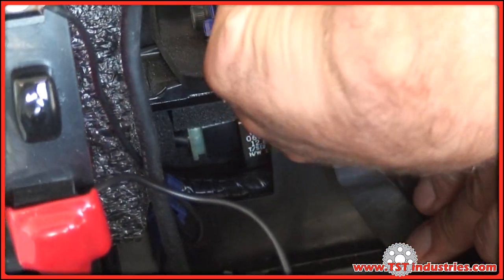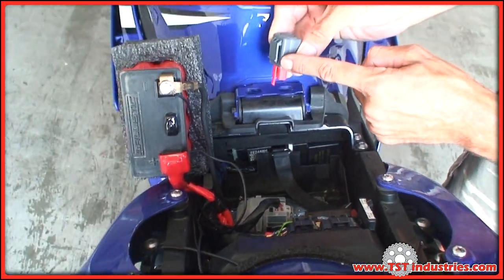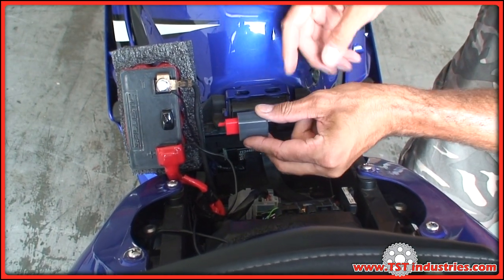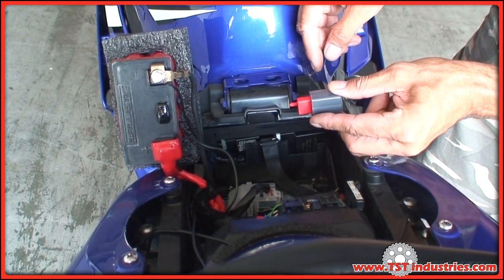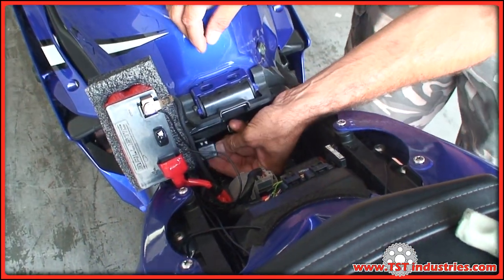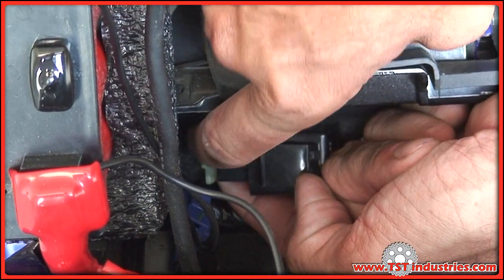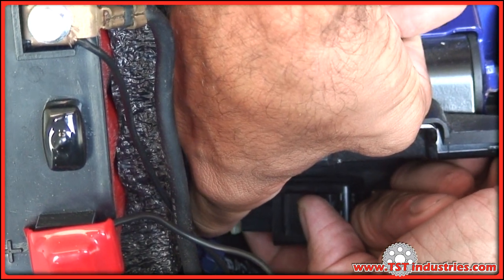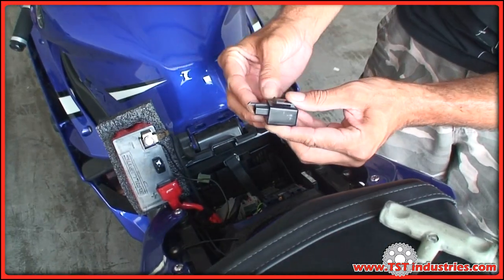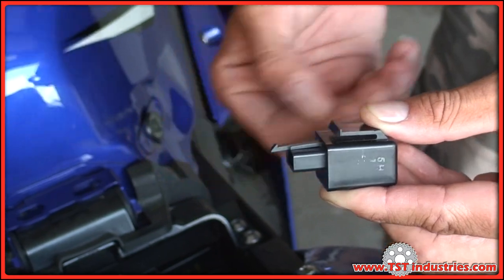The relay is visible right here. It has a rubber clip that this type of clip sits in. It is inserted this way, so you need to take it out in reverse of assembly. Take the connector off by pressing on the black clip and pulling it out. The black clip is what you push down to release it from the plug and pull it out.